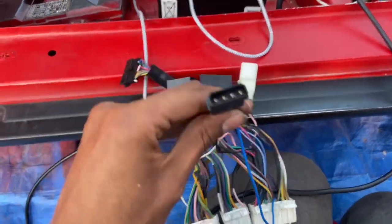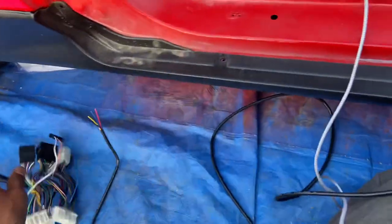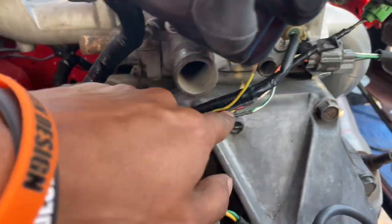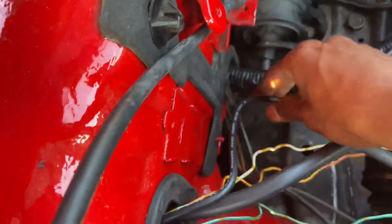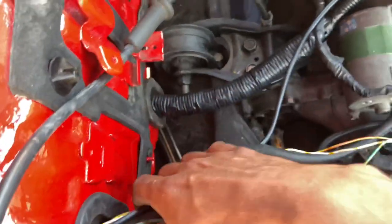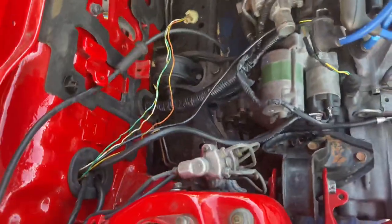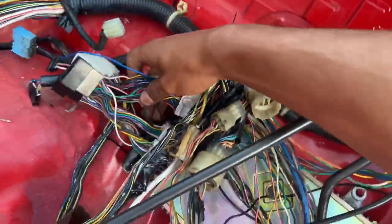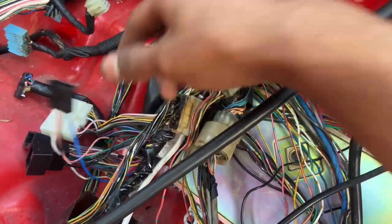Here's our four-wire O2 plug - I don't know why they don't make the conversion harness like this already. Now let's do the same thing at the end of this cable, but first we're going to shorten it. We're right here at this connector, so let's give ourselves enough cable to tuck it - maybe something like that. This conversion harness is going to be coming out of the ECU and this cable can honestly be about that long.